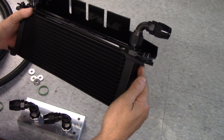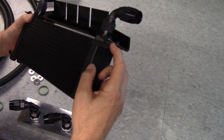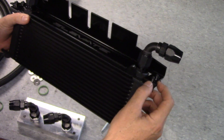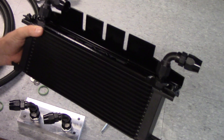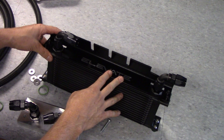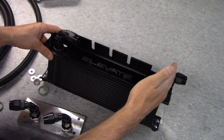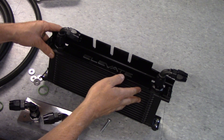It's important — a lot of people don't pay attention to it — but oil coolers need to be rubber mounted. So we take the extra time to mount the cooler with rubber mounts, top and bottom, so that the cooler itself is separated from the shock of the car. Also, as the engine is running, the oil is actually pulsing from the oil pump itself. That pulsing action actually takes a beating on cheaper coolers, and we've actually seen coolers fail as a result.